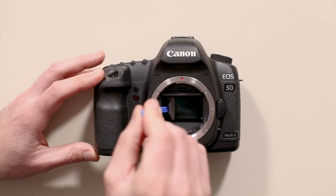Now the best thing to do is to put the lens on, go outside, and shoot into the sky — a nice clean blue sky is perfect. Put the pictures back onto the screen and see if there's any dots there. If the dots are there they will be in the same place as they were before — that's the dirty sensor. And if they're gone, great, you've cleaned your sensor. If they've not gone, just repeat the process again, and as long as you're doing it nice and softly you can do it again and it will be absolutely fine. Make sure you check the images on a computer monitor where you can zoom right in to see if there's any dots left — that's the best place to view it. Remember, this is not for the faint hearted, do it at your own risk, and if you do it right it's absolutely fine.